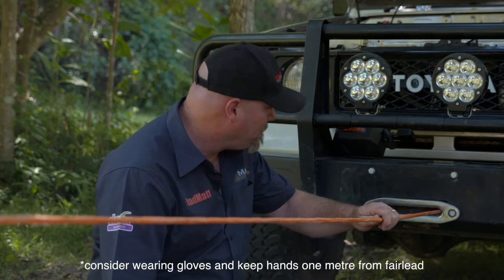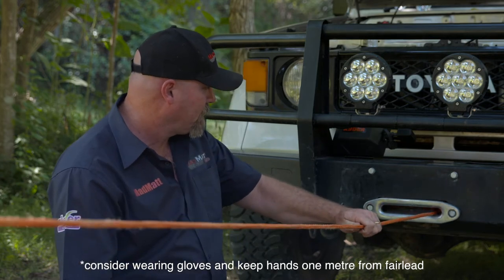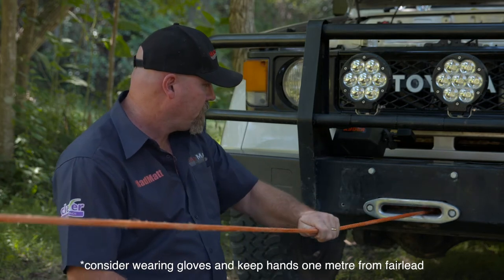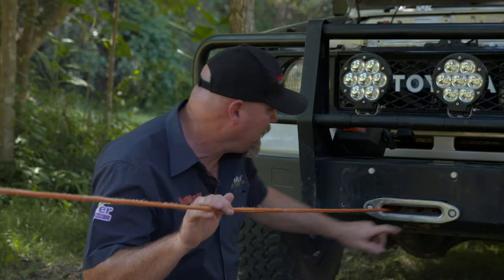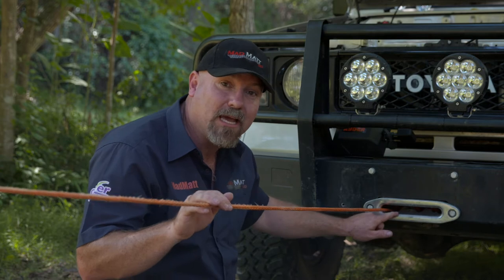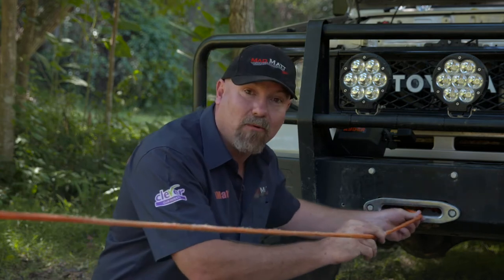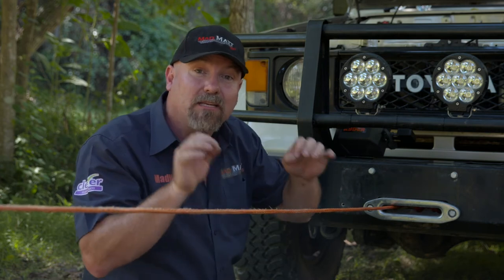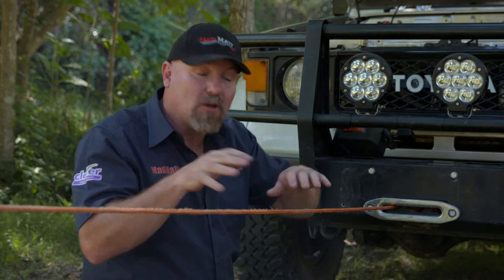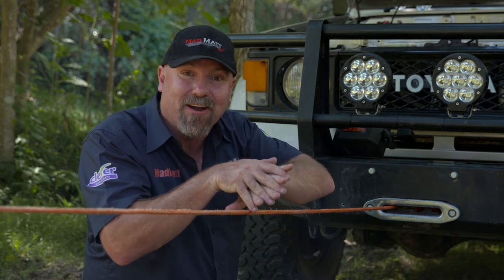Let's lay this cable on. See how quickly I brought the cable across here — as we continue to go in, the cable will go back across that way, and that will create this crosshatch pattern, which is going to stop that cable burying down inside itself.